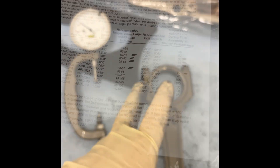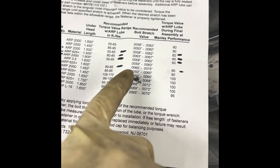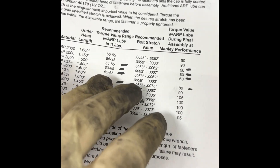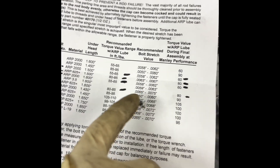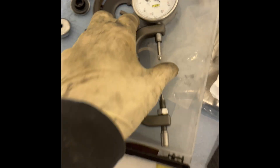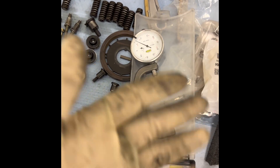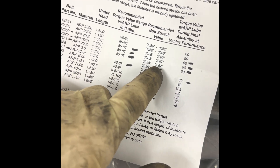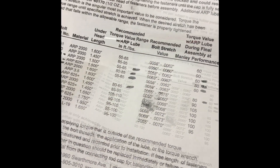I started at 60 foot-pounds like the spec said, but it didn't get me where I wanted, so I loosened them all up, tried again at 65 — and 65 got me exactly where I needed to be. When I say 58 to 62, the proper way to say it is five and eight-tenths to six and two-tenths thousandths, but it's easier to say 58 to 62. As long as you're keeping track of the decimal — if I'm using this tool I know I need to be at the six-thousandths value, not 60 or 600.